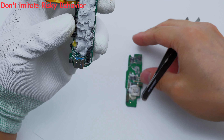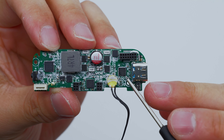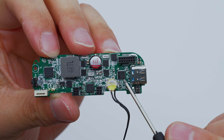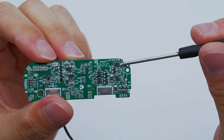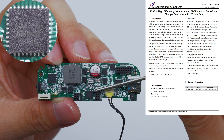The inside is filled with potting compound to enhance heat dissipation. The front of the bottom PCBA module is welded with a micro switch button, screen connector, MCU, synchronous buck-boost MOSFET, solid capacitor, and other components. On the back there are TVS diodes for interface electrostatic protection, battery balancing chips, touch detection chips, and memory.